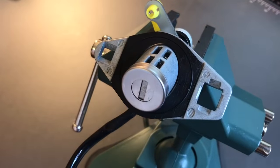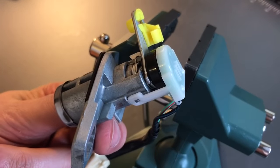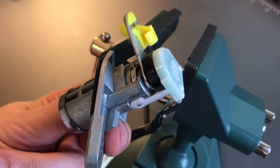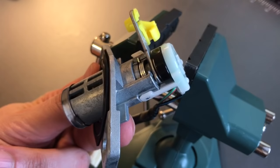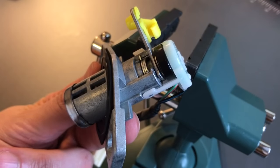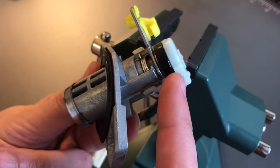Before we get to picking this lock, there's four features about it that I wanted to point out to you. The first has to do with this wire that comes off of the lock assembly. If we look at the back of the cylinder, we can see this white sensor clipped to the back. That is a sensor that detects rotation in the lock core and feeds that information into the security system for the car. So the car knows if the core turns on the trunk lock, and the car knows if the trunk opens. If the trunk opening is not accompanied by either the core turning or someone using the key fob to open the trunk, the car knows to set the alarm off. The interesting aspect of this for us is the act of picking the lock also disables the alarm.